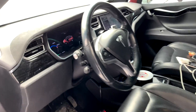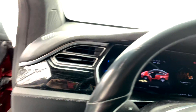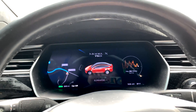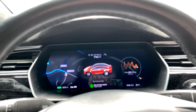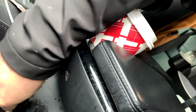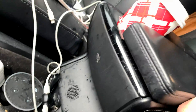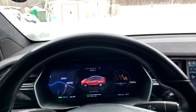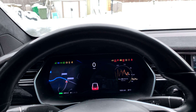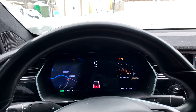There we go. Now that the door is unlocked and open, hop in, close the door. Car is off — if you hit the brake it says 'key not in vehicle.' So what you do is take the key fob and hold it right there to the side of the 12-volt socket.